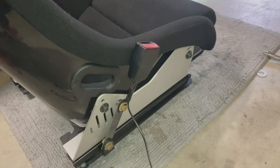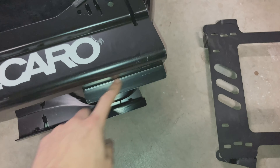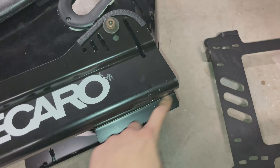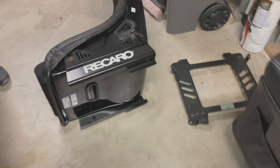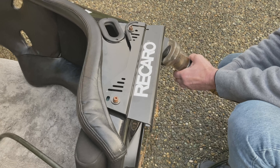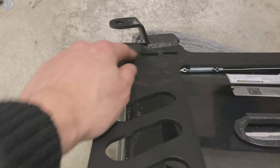The other thing we had to do — the aluminum brackets I used on the driver's side don't have this lip on them, and the Planted brackets don't have space for that lip to go. So we basically cut these off on both sides — shouldn't cause any structural issue, but these are probably designed to go with a certain slot. Two of the holes lined up on the Planted bracket but the front one didn't, so we just drilled those.